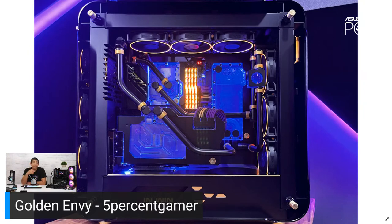We feel pretty confident. We've tested hundreds of CPU samples and can tell you that generally in about 80% plus of cases, regardless of the density and IC, which do play a part, you're going to be able to get to up or around 6000 MT. Once you get to that range, there will be definite CPUs that could reach even higher values, like 6200, 6400 MT, but that's going to be more variable. There's no way to guarantee that, and it doesn't have anything to do with the board.